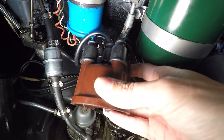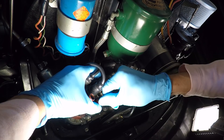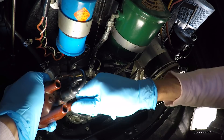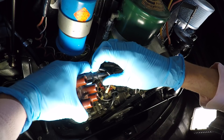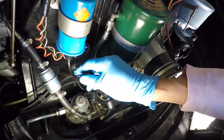If you ever get confused by this, just take a picture with your cell phone — super easy. I want to pull the caps up first and then work each wire out. Go around in a circle and they should pull out like that. They can be a little tough to get out sometimes. There we go — and the coil wire out here as well, and this last one. All the wires are out of the distributor cap.